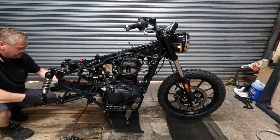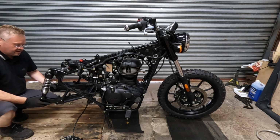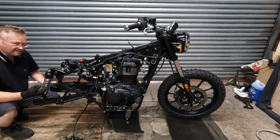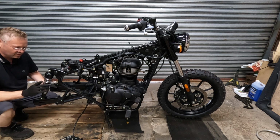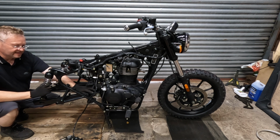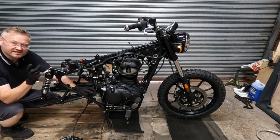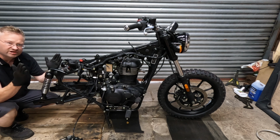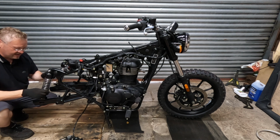That's tightened up. Okay, so there's no play in it. I'm just wondering now whether I've cinched it up and that's somehow not working properly. But I'm sure it is because of the bearings. There's a thing called a crush tube, so it can only be a certain length. It can't be crushed so much that it's tight. So I'm sure.